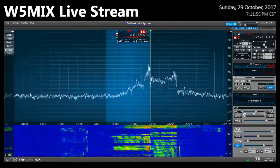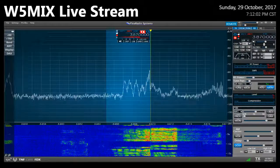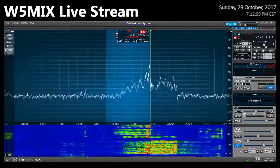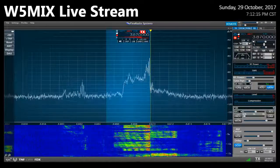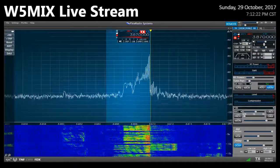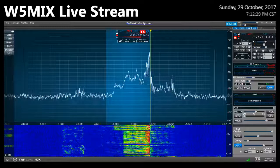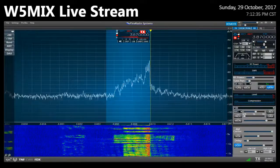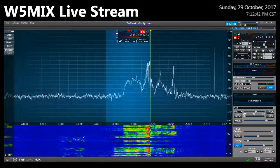It's pretty quiet. I put one on my 76, and I was pretty impressed by how quiet that thing is. But it still moves some air. Well, from what I was reading in the description, it's lower RPM, high volume, so you don't get that noise. Yeah, a high-speed fan tends to make more noise. At higher speed it could do 105 CFM, but at the speed they run, it's about 65. No, according to them, at the speed they're running at, it's 51 CFM. Yeah, still more than the little squirrel cage can flow through it, so it'll be slowed down to about 40 when it goes through there.